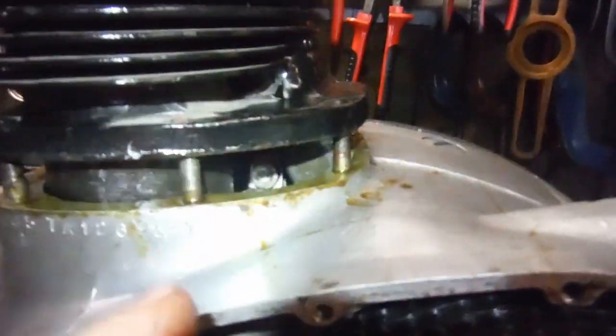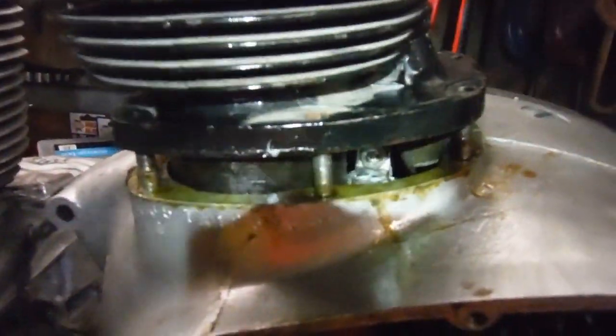I thought it was that welding across the web in the crankcase probably catching something, but I've had a look and it isn't. You would not believe this — let's see if I can get a little screwdriver to point at it — but it's actually the tappet housing in the cylinder barrel fouling on the edge of the mouth of the crankcase. Look at that there, it's actually touching, and the barrel actually wants to slew round to the right a little in order to fit over the studs, but that is stopping them.